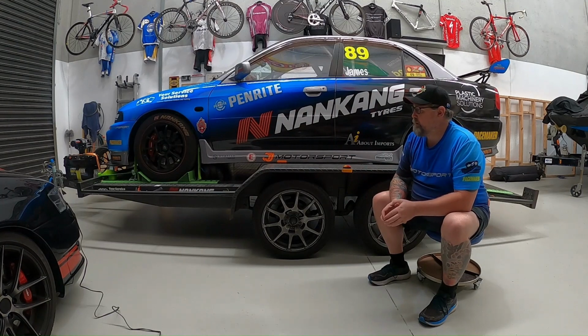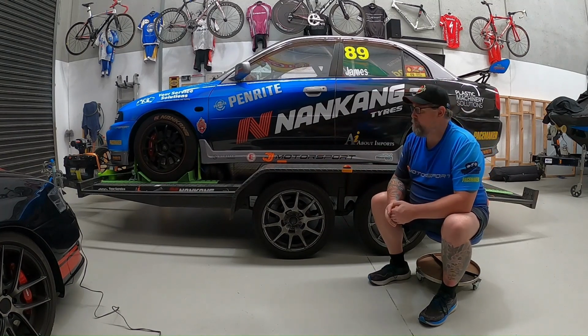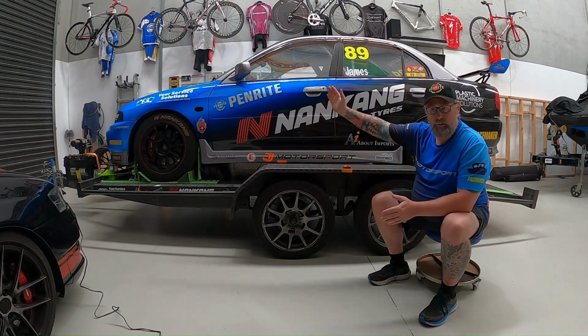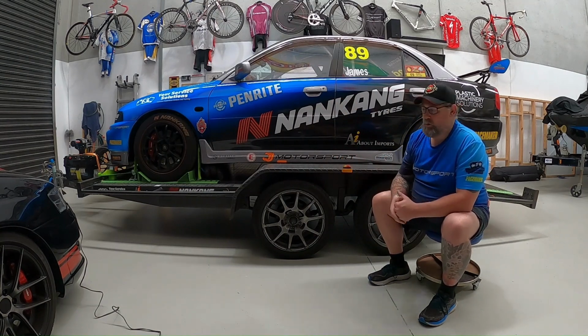I'm a little bit on the safer side when I tow my cars around. Having more straps is definitely better than not having enough. You're supposed to have it tied down at 4 points anyway. But the thing I like about this system is that when you have movable chocks, you don't necessarily have to have chocks on the front and rear of the wheels. These kits come with 2 tracks and 2 chocks, so you could just have the front chocks on, one on each side, for when you're loading the car on, to gauge where you want to position it.